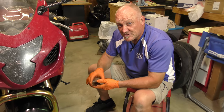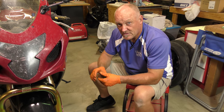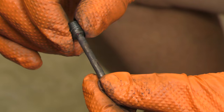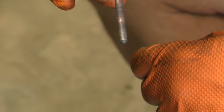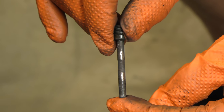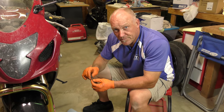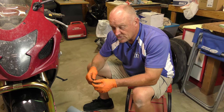That's possibly the beginning of a sticking piston, but we are getting in there with a toothbrush so that should alleviate the issue. Now remember we were talking about flat spots hanging everything up — you can see that one as clear as day. There are a couple of dig points in it, but yeah that's pretty obvious, so the order for the pins became urgent. On this one you can see from the pure silver where it's taken all the anodizing off — that's even worse than the other pin. So big hang up on this side, and that may explain why the pad wear is very different left to right. As soon as we get these in hand we can swap those straight away off the caliper between wheel changes, so this is urgent.